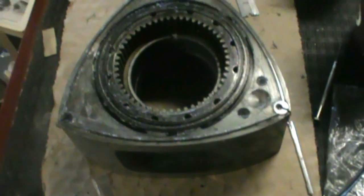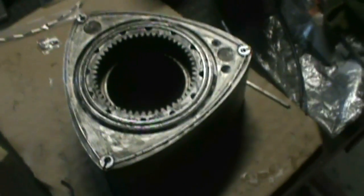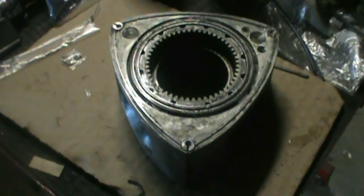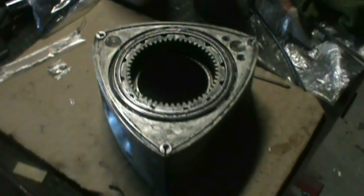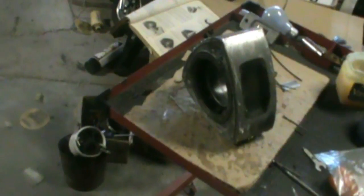So anyways, I'll just do that and then I'll get started on the other side, and then once I move on to the other rotor I'll go in more depth because I've got to check over those side seals on that one, so just hold on. Yeah, so there's just one last look. I've got it all caked with Vaseline, so hopefully those seals stay in place. Getting to work on the other ones.